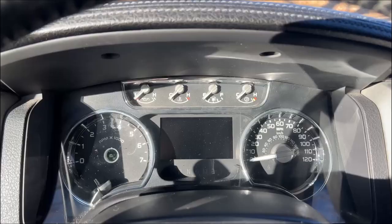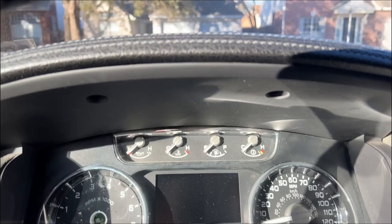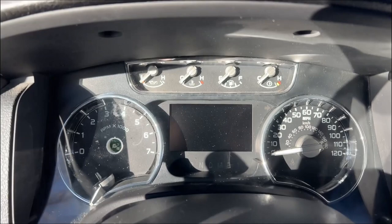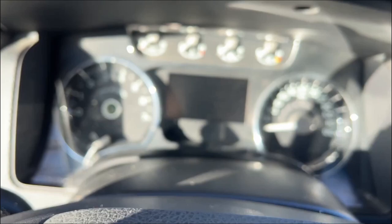Back in the car. I believe there are only going to be about six screws that we'll have to pull out. Starting out, there are two up here, and then we're going to have to pull this trim piece on the sides up top — that should come out and give us access to the four screws holding the cluster in. I believe two are up top and two are down at the bottom, but you'll see those when I get this first trim piece off.